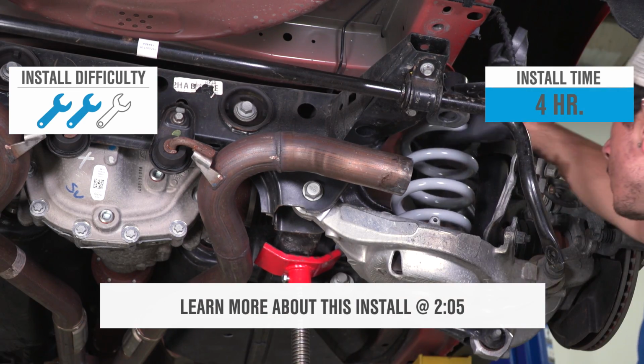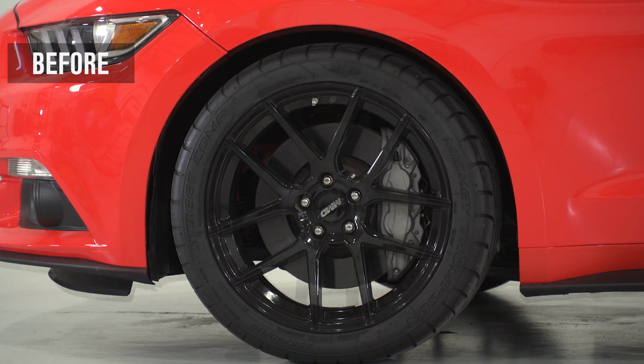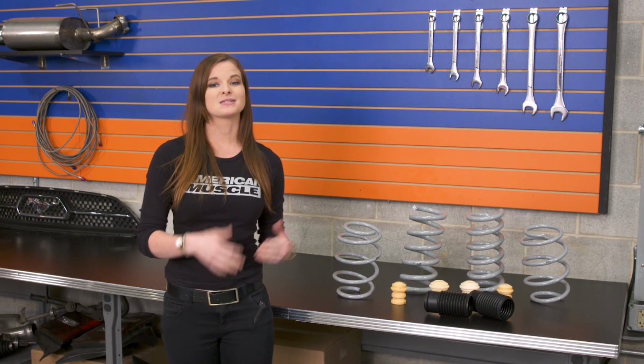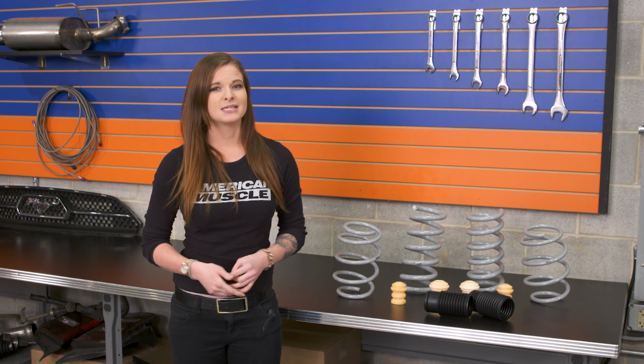These springs don't give the same drop all the way around the car, but instead they give a precise drop that RTR feels is better in both categories. These springs offer a drop of 1.1 inches in the front of the car and 0.8 inches in the rear. Now this is what I consider more on the standard side in the world of lowering springs for the S550, because currently you tend to see that the majority of springs offer a standard 1-inch drop. But I'll go back to what I said earlier about RTR thinking that this drop is going to give you the best of both worlds.